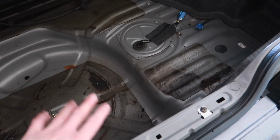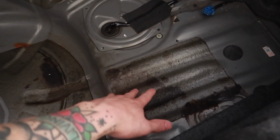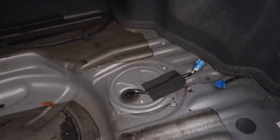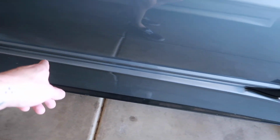So once we figure out that, we'll go ahead and wire up our terminals. Plan is to, of course, run a power wire all the way through inside the car. For grounding, we'll go ahead and use one of the bolts to the shock tower. Then we'll run our power line all the way through underneath the carpet of the Skyline up into the firewall.